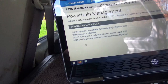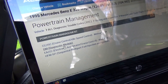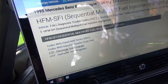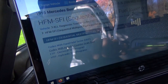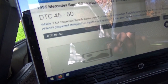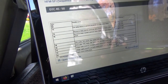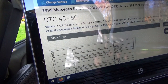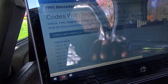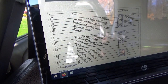On AllData under diagnostic trouble codes we have diagnostic module codes — which we couldn't read at all — and then sequential multi-port fuel injection and ignition codes with the impulse counter scan tool. Code 47 does not exist. So we won't worry about 47 for now, but we're definitely concerned about code 24: CKP sensor.